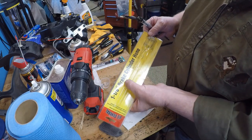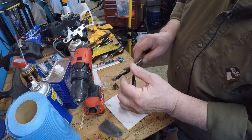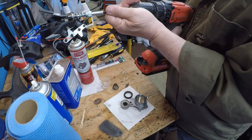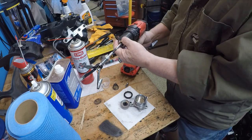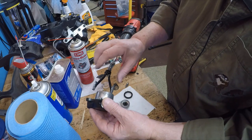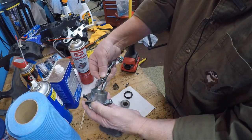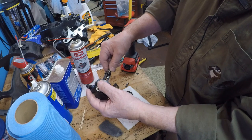Go to Harbor Freight - I've had this and use it on cars: a one-and-an-eighth inch brake cylinder hone. These little stones are real smooth, they won't put scratches in and they don't take anything off the size. You put it in a drill. When I run this I'm not going to run full bore, just go easy with it - start putting those in there, take them in and out for a while, then check it. They're spring-loaded: you squeeze them together and put them in.